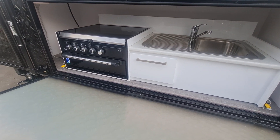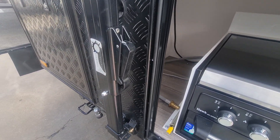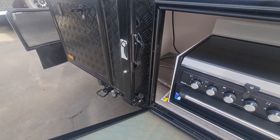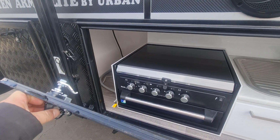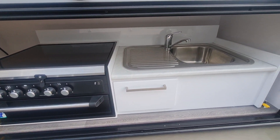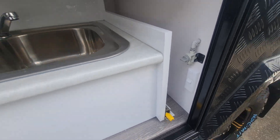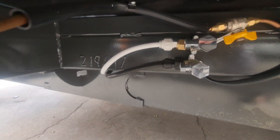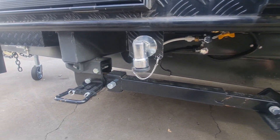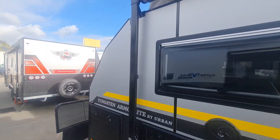That's your slide-out kitchen - it pulls out and your water connections are underneath. It's as simple as connecting it up with washing machine hose lines, which are predominantly what we use. I'd recommend the rubber ones over the galvanised-coated ones for durability. That bleeder in the corner bleeds the air out of your roof and turns the pump on to push the roof up. The taps are just up there - you connect them on and plumb your kitchen in. There's also a gas bayonet to hook your barbie or outside cooker up.